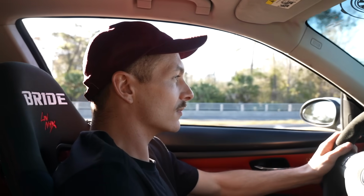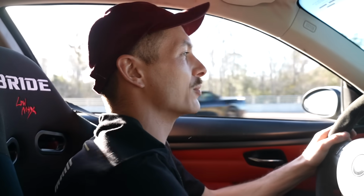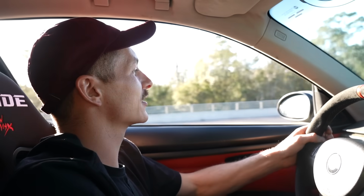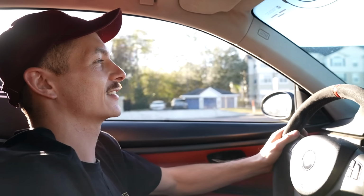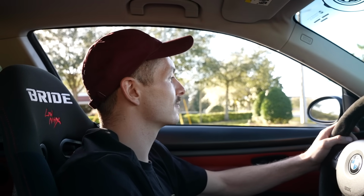Try 2 and 3. Broke up at the top of 3rd, but the second pull was good at least. I'm probably doing damage by doing this. There's a smoke trail following us. All right, we'll let Jordan do the rest. We have established that the car has enough compression to still feel fast, but it definitely doesn't sound healthy. There's a lot of breaking up going on. Hopefully it's just rich and not lean. Yeah, that would be ideal. Or just bad plugs. Probably a combination of the three.